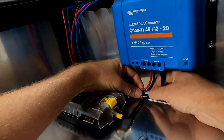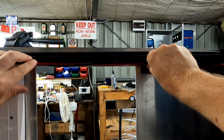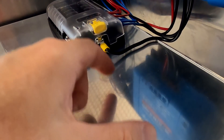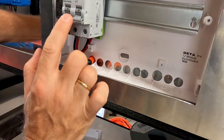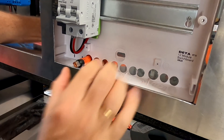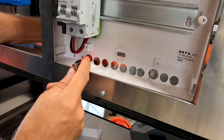I'm trying to organize the cables from the back of the converter, using either some split loom or some spiral wrap to organize them. I'm still waiting for the smaller fuse block for our 5-volt distribution. I've read the comments — people said it's not really necessary to fuse a 5-volt circuit, and that's totally true. This is just me organizing my circuit so I know where they come from and where they terminate, and I can pull a fuse to disconnect a single circuit from within the switchboard. You are absolutely right that technically it's not necessary.